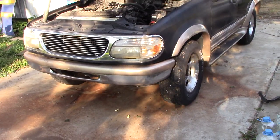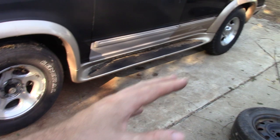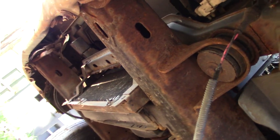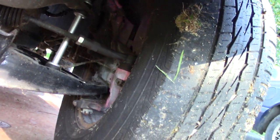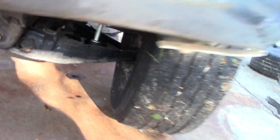Another really cool thing about this vehicle: it is super clean. No rust all over the body — there might be some hiding behind the plastic fender trim, but the actual frame is pretty darn good. You've got your typical brown surface rust, but it's solid through and through all the way to the back bumper. Motor mounts are good, core support is clean. Somebody put serious money and time into keeping this on the road — brand new lower control arms, stabilizer bars, sway bar, brand new upper and lower ball joints, brand new tie rods on the steering.